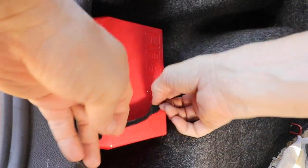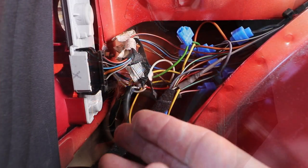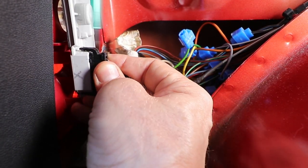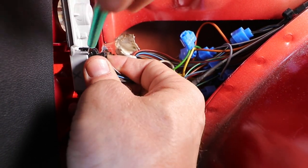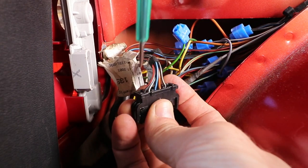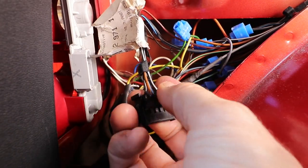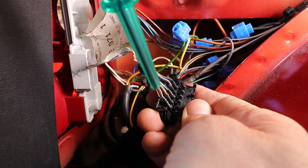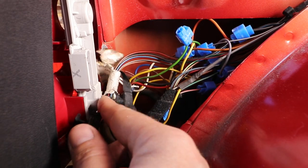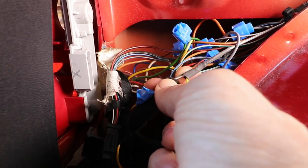If we look around we can see the connector with a blank terminal and wire missing at the bottom, so we just need to take that off. You want to turn it round to open the connector — it just prises open to one side — and this is where the female terminal will go. I've already connected mine to the grey and white wire just here. I did film the soldering part but I made a mess of the film so I can't really show you that.